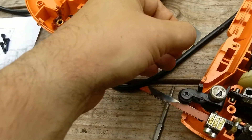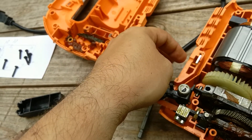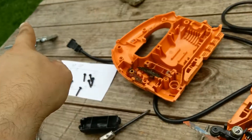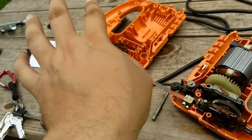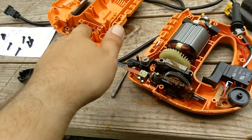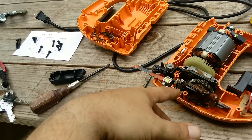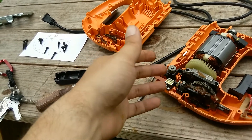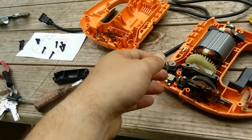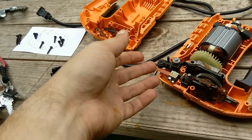You have a little metal thing here that the screw goes into for the bottom, for that adjustable cutter — the cutting thing. The rest is just mechanical. A lot of these, the blade doesn't go up and down and it doesn't work. You think it's broken, that something snapped in there — actually it didn't. It's a real simple fix, though there's a lot of grease involved.